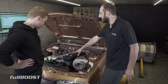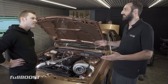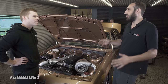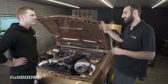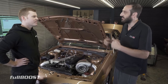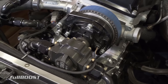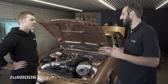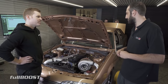Fuel pressure — we've done a fuel pump change on it because at the last meeting it went 810, just over 810 I should say. Then we turned it up, it launched and it fuel surged. So the engine protection came in because we saw a fuel pressure differential move away. It tried to correct it, couldn't correct it, and it killed the motor. Today we've put a bigger pump on it, and because of how good the fuel model is, the tuning was very minimal to get back to our numbers. It corrects and compensates in so many ways.